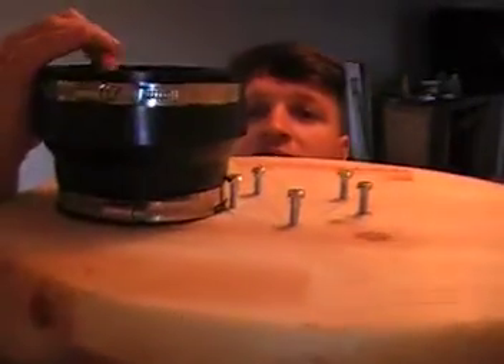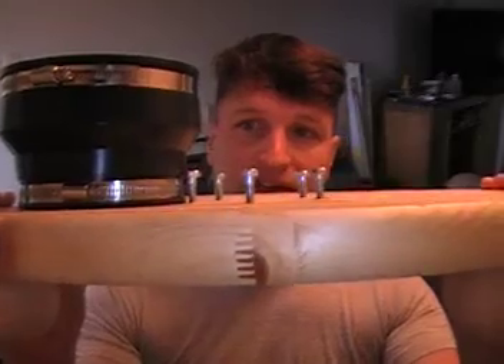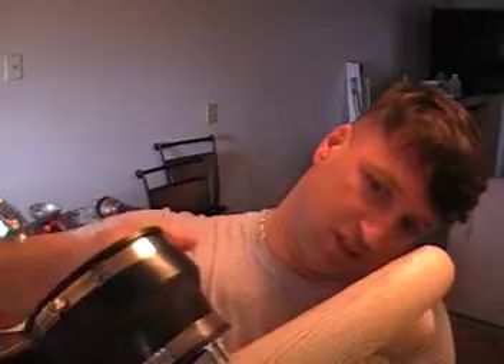As you can see there are two tightening bands — one on the top and one on the bottom. You're going to drill the screws in basically to the height just above the height of the bottom metal band, so that when you put the gasket over the screws and then tighten it up, it's locked onto those bolts or screws and it's not going to go anywhere.